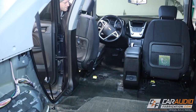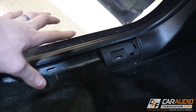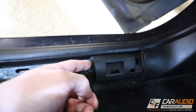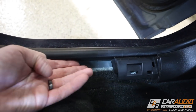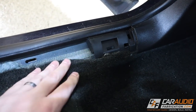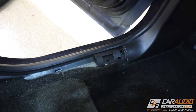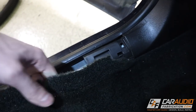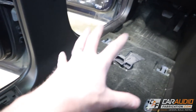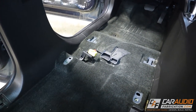I ended up having to do something I was hoping not to have to do, and that is to actually pull the seats out of the inside. The reason is if we look at the door jamb here, this particular piece of plastic has almost like a blocking wall, so you can't easily just run a bunch of wires through here, especially large zero gauge wire. I've been noticing this more and more in vehicles lately — I feel like the manufacturers are doing this on purpose. So what we need to do is pull back the carpet some and go through this low tucked point here. It's just better and easier to pull the seat out so we can push the carpet back much more and get a better routing path.